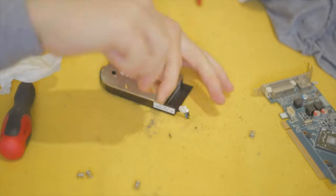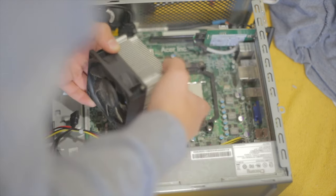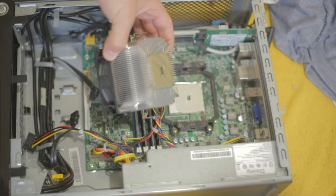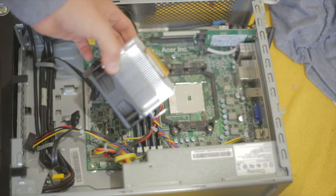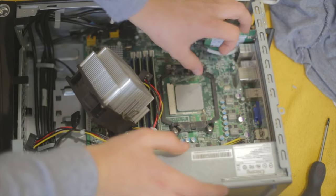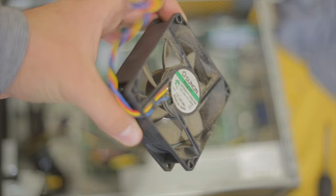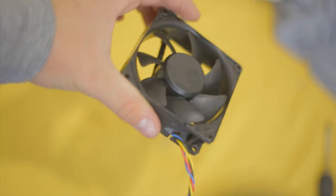After dealing with the GPU, I moved to the CPU fan, which was also very dusty. I took off the whole heatsink and to my surprise the entire CPU came out of its socket stuck to it. Thankfully none of the pins were damaged. I had to use a screwdriver to pry the CPU off the heatsink. The thermal paste on the CPU was absolutely horrible and crusty, so I replaced that as well. I cleaned the fan, took all the dust out, and now the whole system is very clean on the inside.